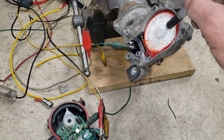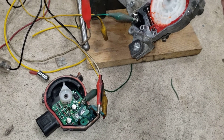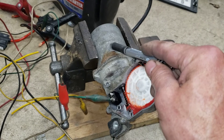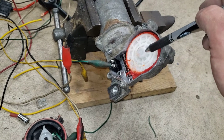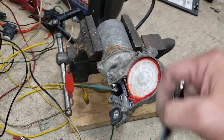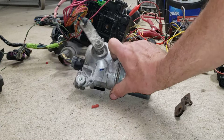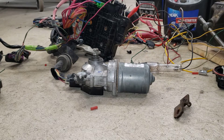One time when I put it back together I noticed it was spinning in the stock, original direction — but my wiring had never changed from when it was going in the opposite direction. The light bulb came on: maybe all you have to do is take this casing and flip it 180 degrees and put it back on, and the motor will go the opposite direction without touching any of the wiring. Lo and behold, that's what you do.